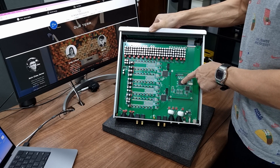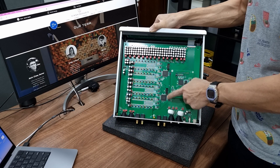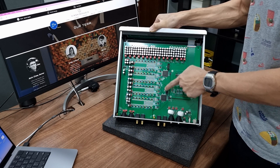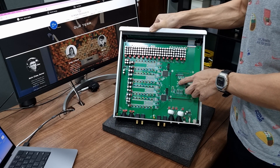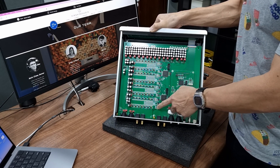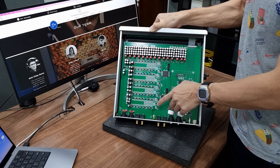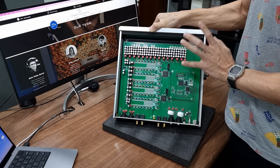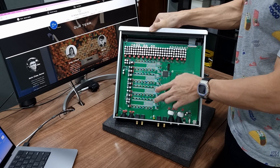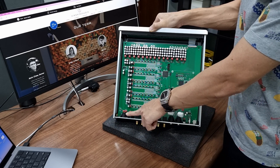The digital signal is sent from the FPGA through two small but very important galvanic isolators. These two pieces are high-speed optocouplers that isolate the digital signal before sending it to these two CPLDs — microcontrollers that process the digital signal from the FPGA. The signal processed by the CPLD is then sent to these small chips for the R2R circuitry. You'll notice there are four resistor ladders here, because all Denafrips DACs are true balanced — left channel, right channel, both positive and negative phase.